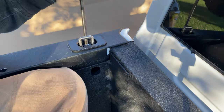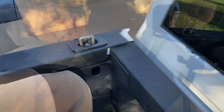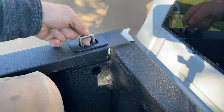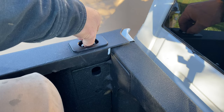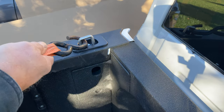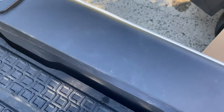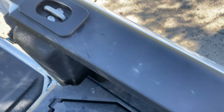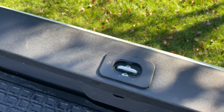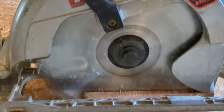Then I'll repeat the process again, tighten the other side, making sure that it's not pulling up on the plastic, that it is, in fact, on the metal part of the bed. And that's how you install retractable tie-down anchors. They stay in the up position, making it easy to hook up a ratchet strap, and then they push right down for nice, concealed hooks. So that's how you install retractable anchor points on your pickup truck. I'm HowToBob. Thanks for watching.